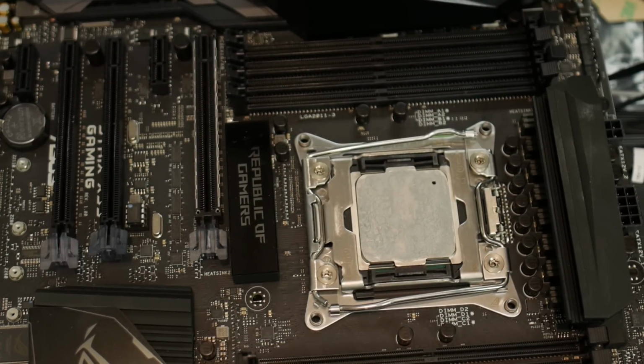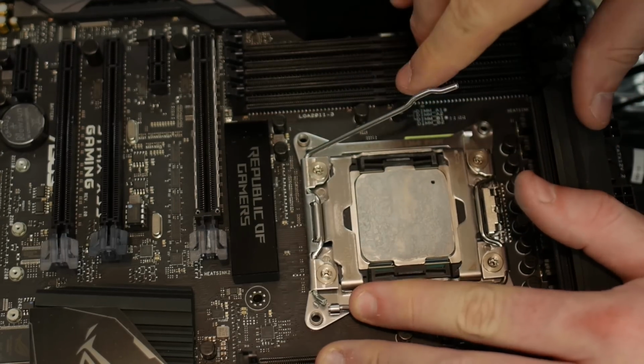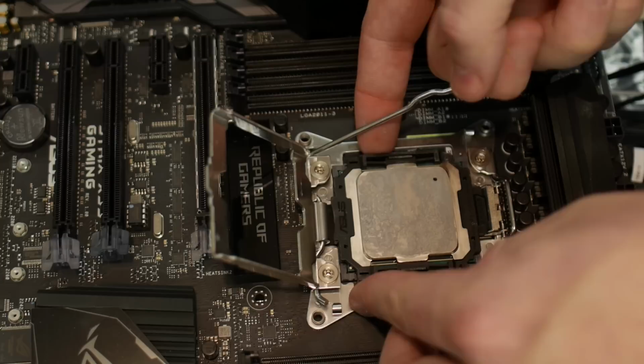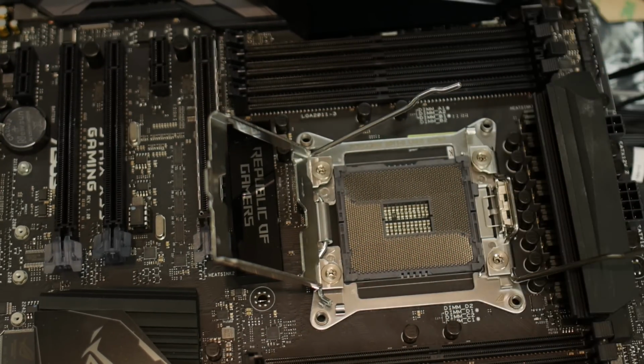If this is something that you're super paranoid about being a DIYer, this will probably help you install the CPU without actually destroying your system. Don't forget to remove the sticker as you gently lay the CPU in the CPU socket, and you gently use the tension clips to close your CPU on it. It also makes it easier to remove the CPU. So if you get an upgrade 5 years from now and they haven't changed the socket, hint, they will have changed the socket, you could swap CPUs if you wanted to, and that would be completely fine.